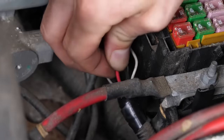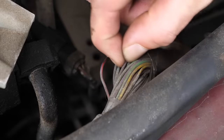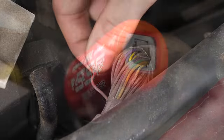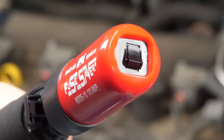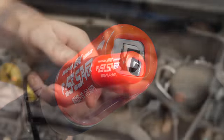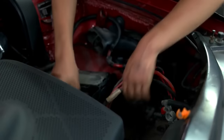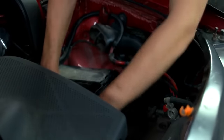Once in place, you can begin moving around the vehicle, shake testing and looking for the short. Once you disturb the short and an over current or short occurs, the fuse saver breaker handle will blow and the buzz alert will sound, telling you it's time to reset the breaker handle. You can then continue searching for the short until it's found without wasting a fuse.